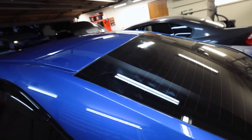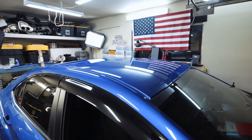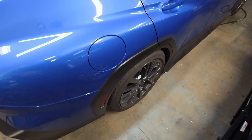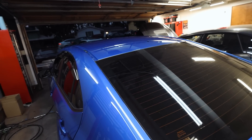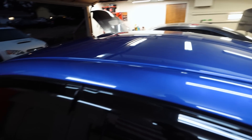I think the black roof will make the car look better - I'm already committed at this point. I've cleaned the roof with alcohol, I'll clean it one more time and get this big sheet of vinyl laid on the roof. To wrap a roof it's pretty easy: use wrapping magnets, a squeegee, a heat gun, and alcohol to clean everything. Lay the vinyl down, start in the middle, work your way out to the edges, get all the creases and air bubbles out, make your cuts, then tuck it all underneath the window trim.